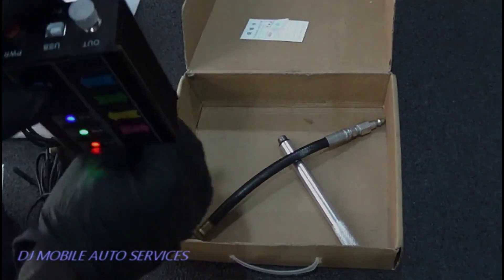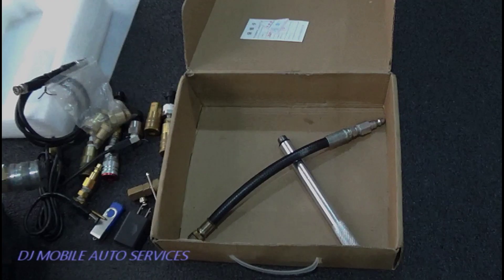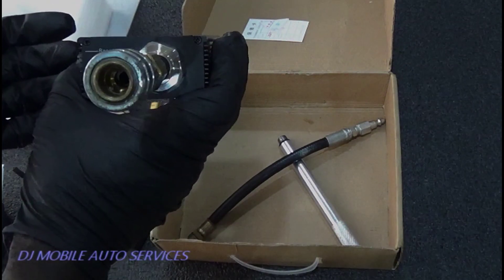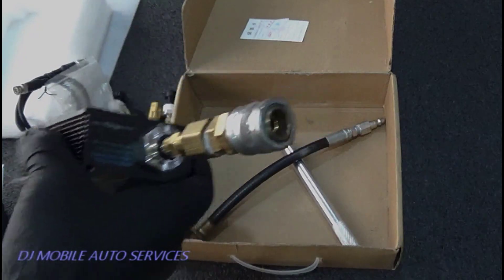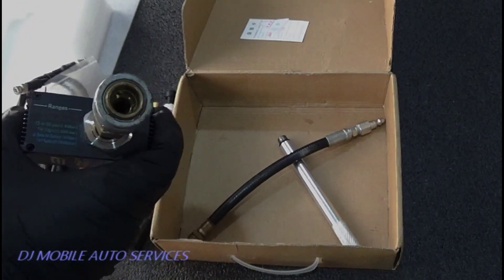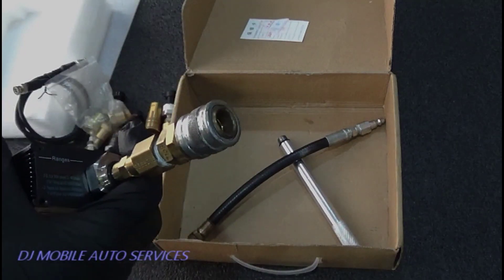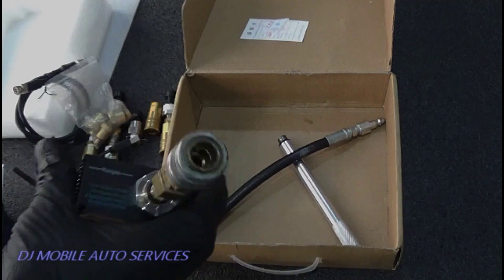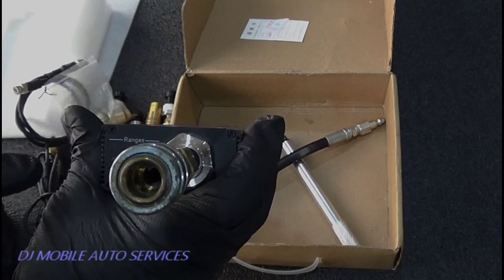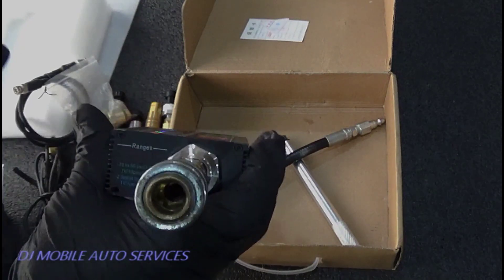The green range is minus 15 to 50 psi, and the blue range is minus 2.5 to 5 psi. For cranking or running compression, I'll use the red range — just press the range button until it's on red. When it's on red, you hook it up, zero it before you put it in, and then do cranking or running compression using an oscilloscope. The green range is for a smaller psi rating up to 50 — probably for fuel, though I'd still tend to leave it on red. For vacuum, I'd probably use the green range.